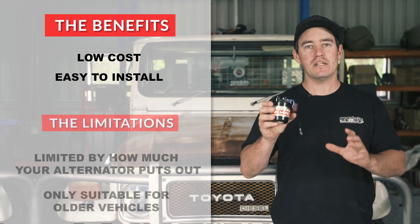You can find your charging specs when you purchase your battery, or by doing a quick Google search on your battery model number. What this means is while an isolator is a cost-effective way to charge your second battery and stop your start battery going flat, it won't keep a battery as healthy as smarter chargers out there. An isolator is great for an old bus like this 47 series here, but they're certainly not for everyone because they don't have voltage and current control. If you've got a new vehicle or maybe you just want a longer life out of your deep cycle battery, you really need to go to the next level of battery charger.